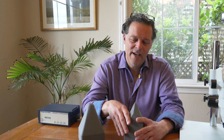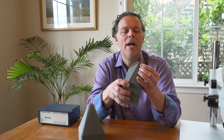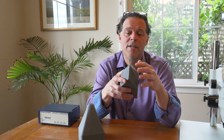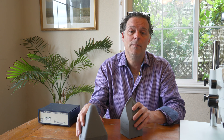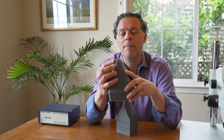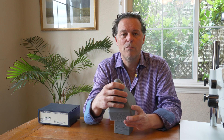A fine line contact stylus starts with a nice tight minor radius — an edge or ridge line, a wedge-shaped edge — that comes in contact with the groove. As this stylus profile wears out, this ridge line eventually disappears and it becomes, in its profile, first an elliptical and then a conical. The ridge line just starts disappearing and then it gets burnished to a nice large rounded radius.